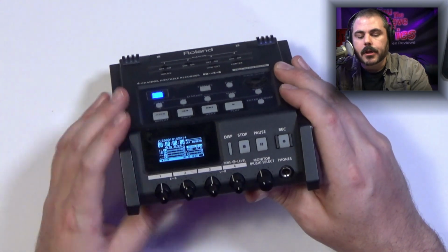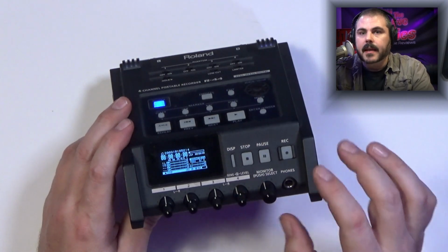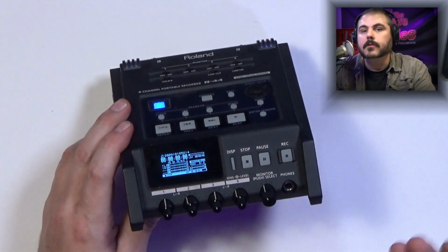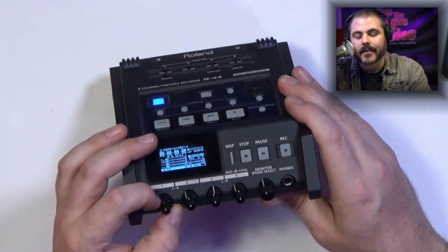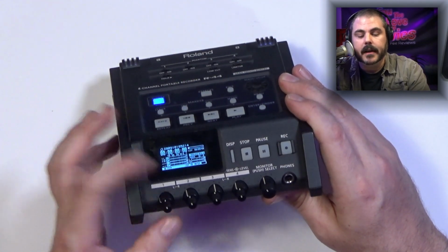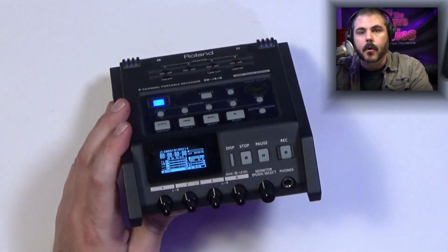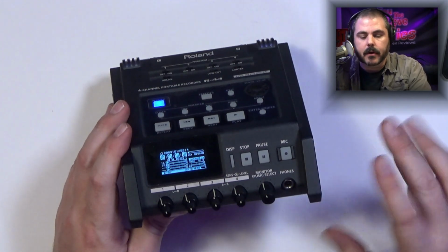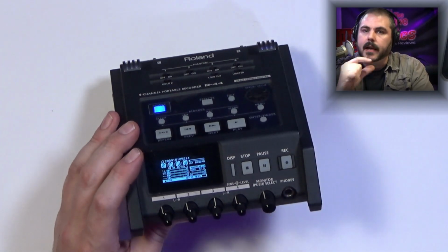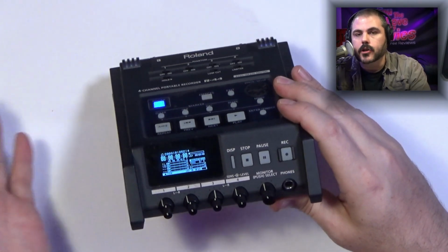So in order to set this up properly, you have to understand that the level is basically like a minor change, whereas the sensitivity or the gain is a much larger change. It's a big change. And on this machine, you can actually feel it click. When you turn that sensitivity or the gain, you can feel it click up every time you turn it up. And that is not something you would want to do during the middle of a recording or during a take, because you will actually hear it get louder and louder every time you click it up. You'll hear that sort of pop, and it will be very noticeable if you were to change that gain or that sensitivity during your shot.